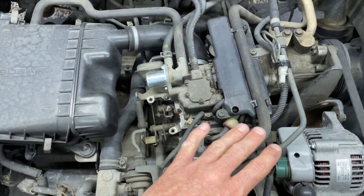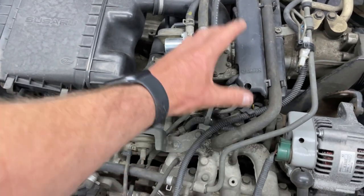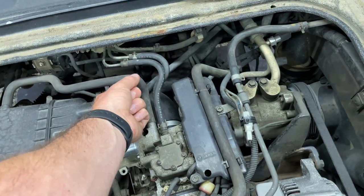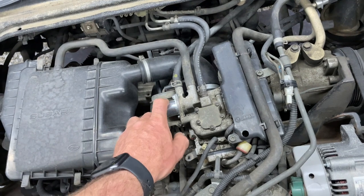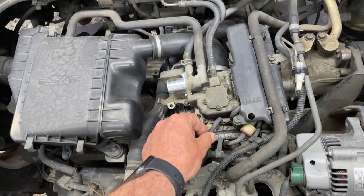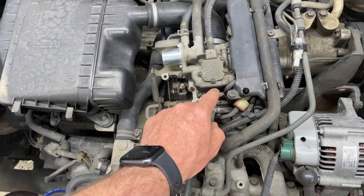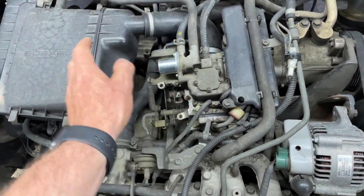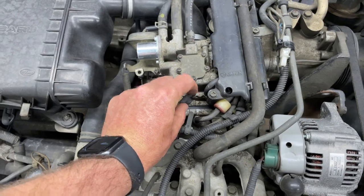Okay, so I took it out back and blew everything off because I left the lid off. Stuff was obviously going to fall in there, and we want to keep this clean when we take everything off. So this is what we're taking off. Take all the hoses. This probably comes from the evap canister, and then that goes to the air box, because I think that's the fuel air, and then it burns it off into the carburetor possibly. Bunch of vacuum lines, which hopefully that carburetor matches. I should probably double check and make sure all these hose nipples are in the same spot as this one, or we may end up having to swap parts from this carburetor to that one, because I think maybe they changed.